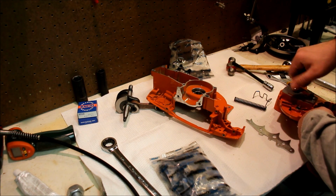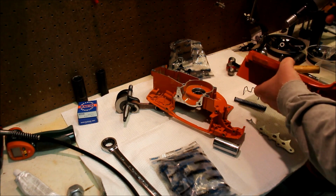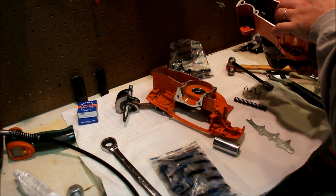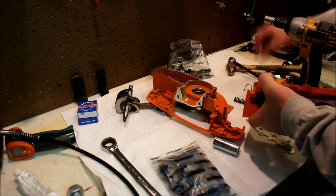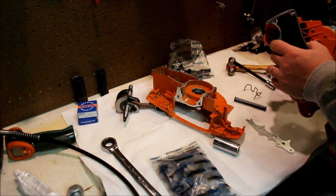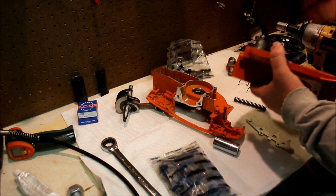So what you're going to need here is probably a couple of washers. You got to make sure this doesn't spin, but you hit it with your impact, 13 millimeters. And just before it seats fully, don't want to go too far without getting some extra washers on there, but just before it seats fully, you can go back and reorient it. So you keep an eye on it going down. I don't know if you can see, but that's pretty well seated. Add a couple more washers.